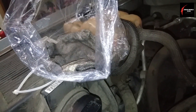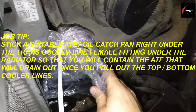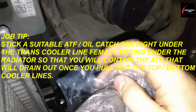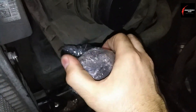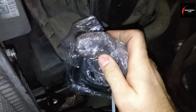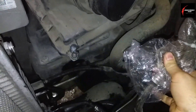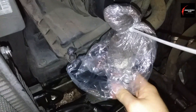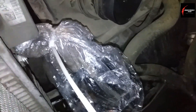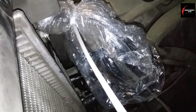In the next clip, I'll show you what it looks like when I'm all done. This is what it looks like when you're done. The tip of the line is right here — I'm touching it with my thumb — and then you have the rag put all the way on it a few inches back, and then you'll stick your zip tie on there. You can just let this hang wherever it wants, and you're not going to have a huge puddle of transmission fluid when you get ready to put the new radiator back in.